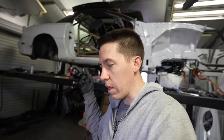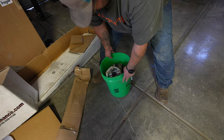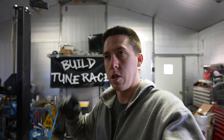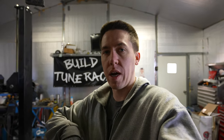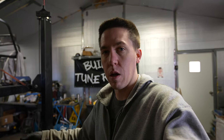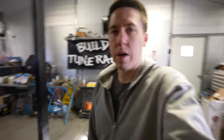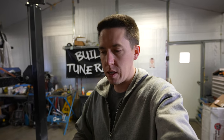This was previously an eighth-mile car with a 3.90 rear gear, and now we've got a 3.0 rear gear - yep, I said that right, 3.0. So this thing is going to cruise down the highway real nice. There's the new 3.0 rear gear, 40-spline, a whole new setup for Salty. With the transmission being a Turbo 400 with a 2.10 first, you do a whole bunch of starting line ratio math. The Buick has a 3.25 rear gear, and even Mincer told us with the shocks we might be getting a little aggressive. I want this thing to really drive down the road nice - no reason not to cruise at 75. The 3.0 rear gear will help with cruising at nice highway speeds and the starting line ratio, and while maybe not perfectly ideal down track, overall it'll make the car much more enjoyable and we should still easily hit the times we want.